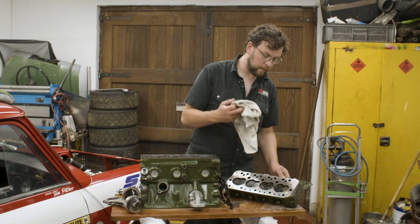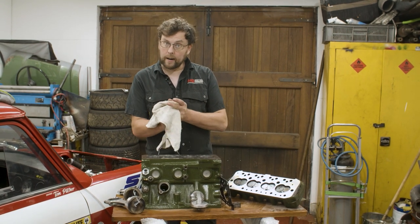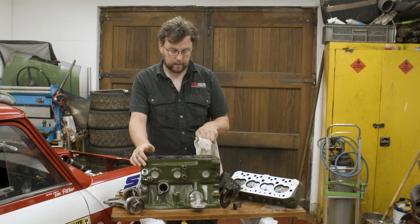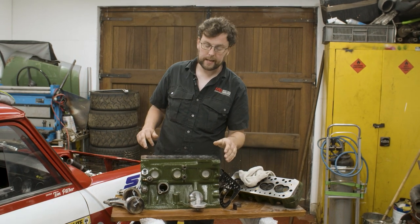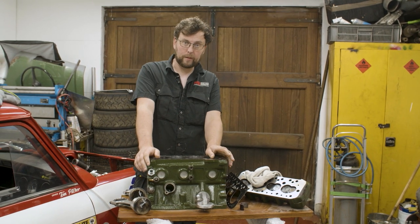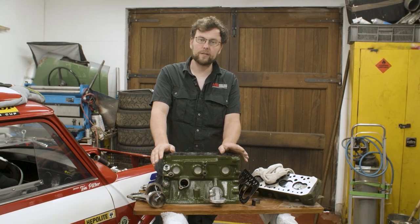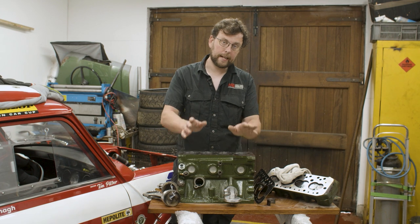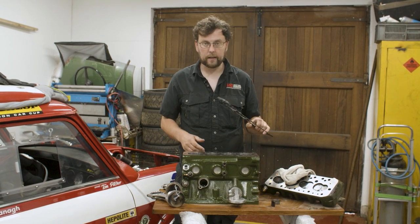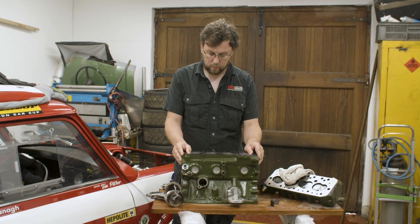That's certainly not something I ever did think about. It was a dimension that when I put this gasket on the block before compressing and torquing the cylinder head there was plenty of room all around the piston, but after it went through a heat cycle or two, the gasket changed shape and that was enough to allow it to come in contact with the piston. I wanted to put that out there so you guys would see a place where an error can happen — and it was a costly one, as we ended up missing a race day, which is not cheap.